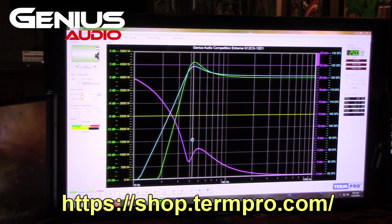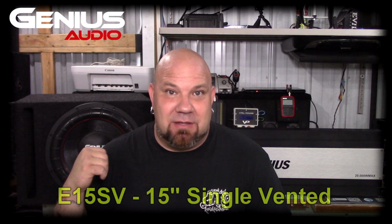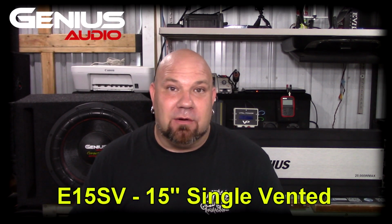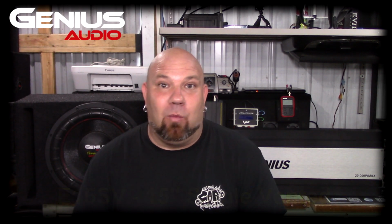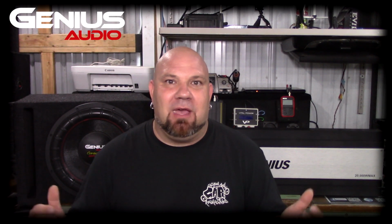But I wanted to see if it will play well as a daily driver in someone's car with a standard prefab box that you could buy off Amazon. So I put in the Trend 15-inch ported box parameters, which is 2.25 cubic feet, tuned at 39 hertz. I put that in with the Thiele-Small parameters for the sub. The graph comes out great. It looks like it's going to play very well. It shows 127 decibels is the SPL output.